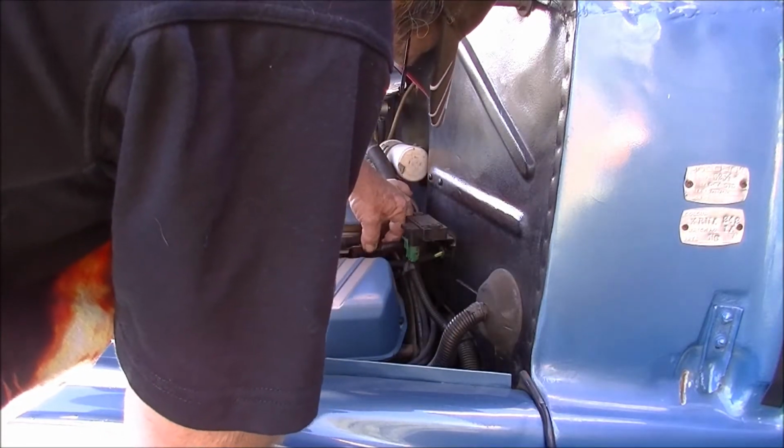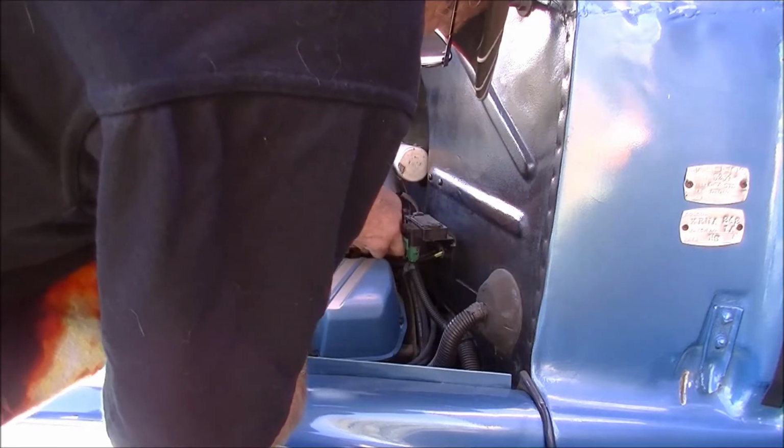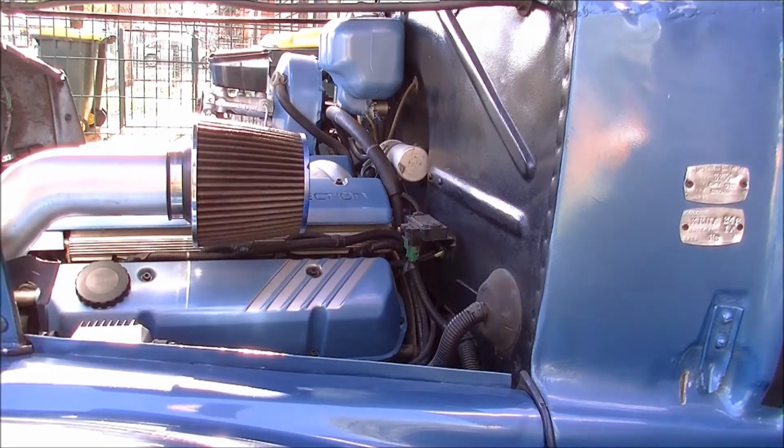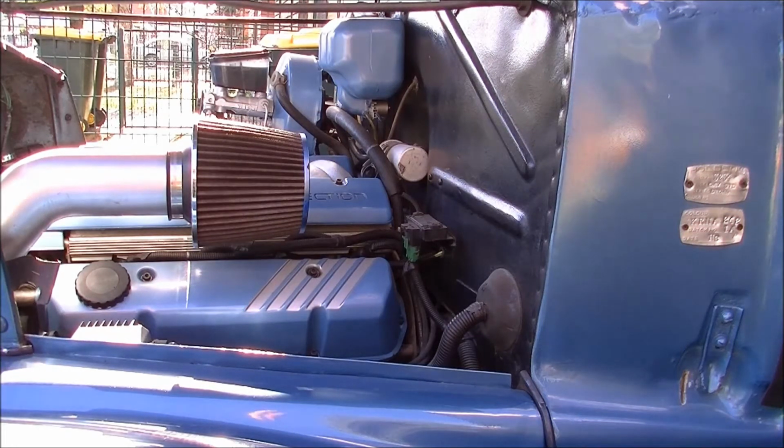So if you've got pulse in yours, Kev, and you know your fuel's not the issue, but you could have flooded it, mate. But it really sounds like you've got an issue with the timing to me. Anyway, so you go check that out, Kevy, and let me know what happens.